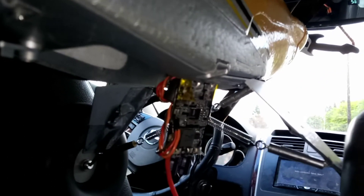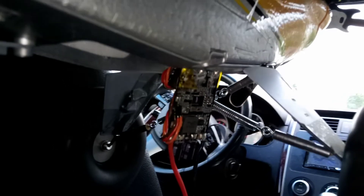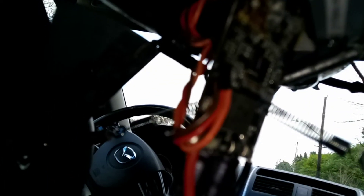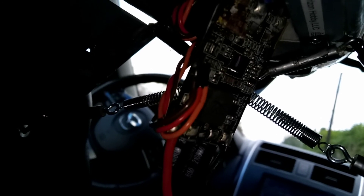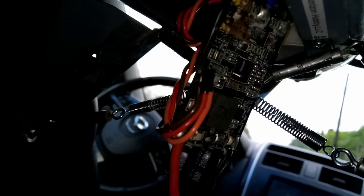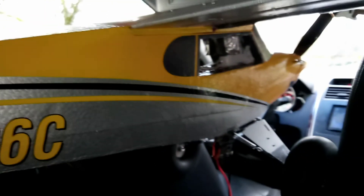All right folks, that's it. That's episode three, the final episode of my crash on the lake. Everything was fine with the bird — no damage except I was getting no power, couldn't power the bird up. It turned out to be the ESC was wet. No matter how much heat and air I put on the ESC, I still couldn't power up the plane. But only about 15 minutes after I pulled off the shrink wrapping from the ESC, with the heater blowing on her, now she works. Super duper. See you next time.